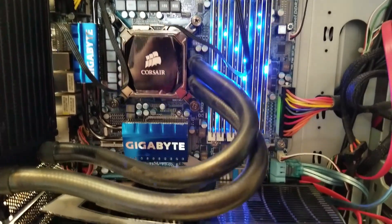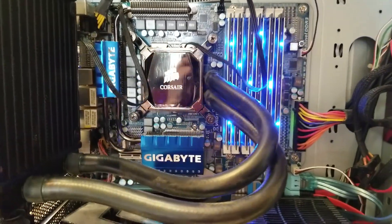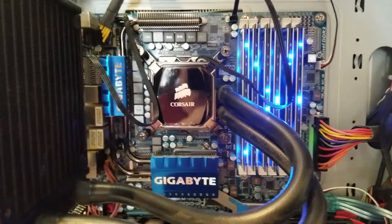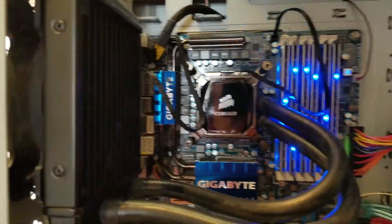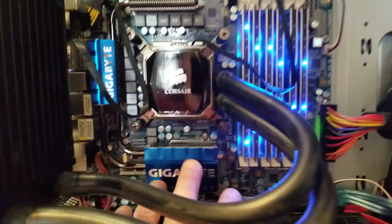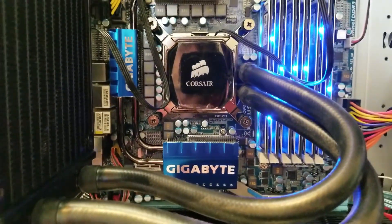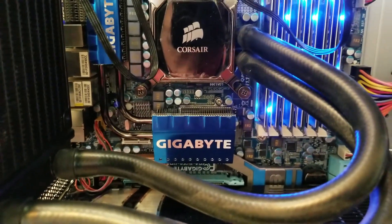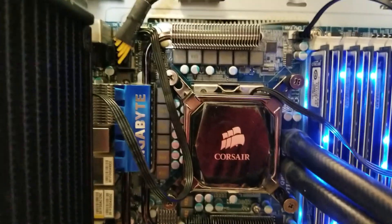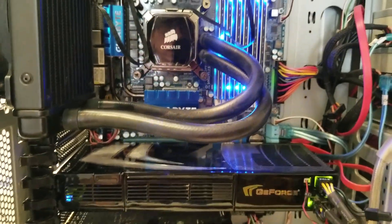Check it out — turns out it wasn't a bad motherboard. Once we got the motherboard out we were able to check everything really well and realized that the BIOS was corrupt. It's a dual BIOS fortunately, so we were able to restore the original BIOS on it. As you can see, it's running Windows now — everything's all back together. We cleaned it out; there was a ton of dust in here and the power supply at the back had a ton of dust on it. We pulled the heat sinks off and replaced the thermal paste on the Northbridge, and also replaced the thermal paste under the AIO — those looked like the original paste. The thermal pads on the MOSFETs looked good but the thermal paste was pretty bad, so we put new thermal paste on. Everything's running well.